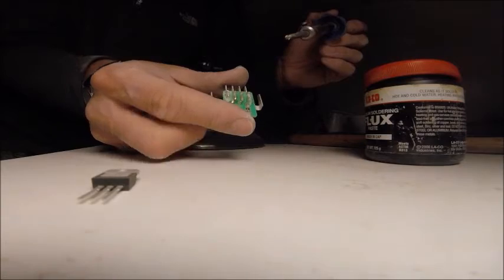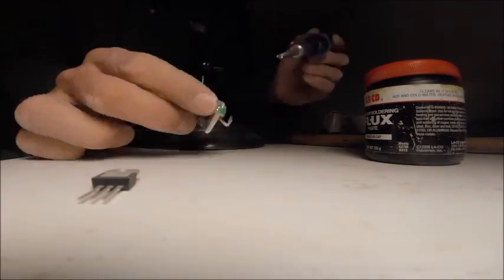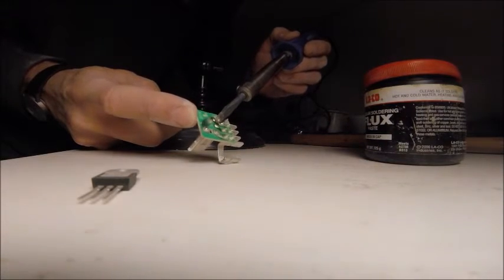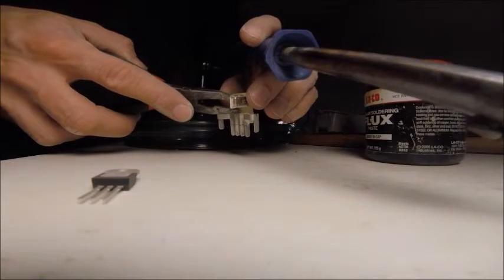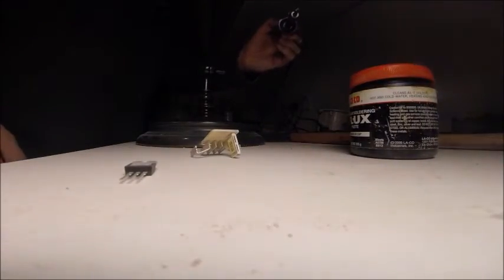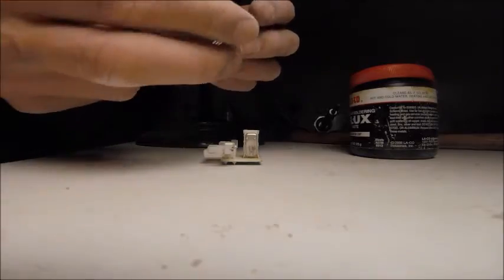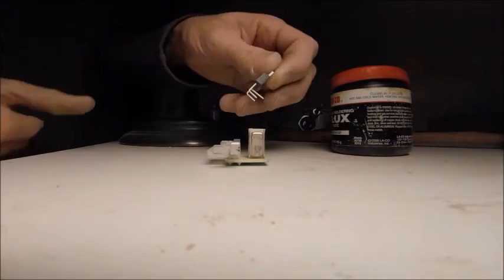Almost out now — apart from the fact it's burning my hand, it's going well. You can just pull each leg out individually, which should be a little easier. So we've removed the old one. The new one has three legs, so I'm going to bend these over with a pair of pliers. I've bent the legs of the triac the right amount and now they fit in the hole exactly where I want them to go.